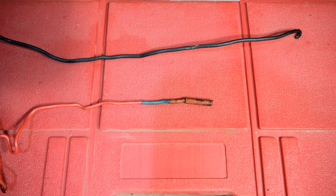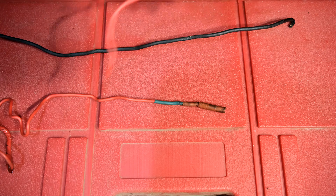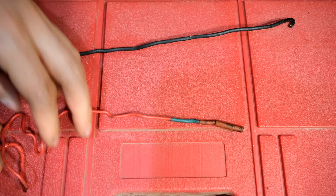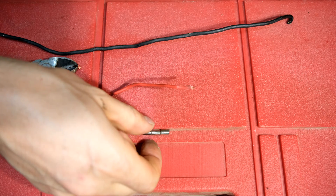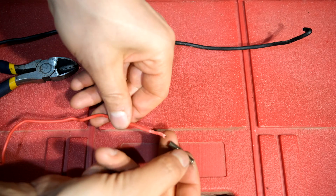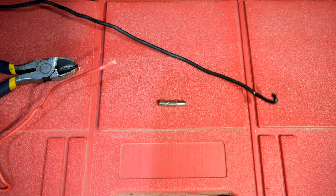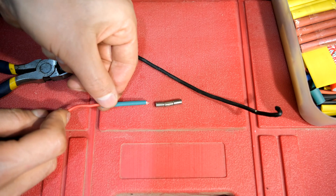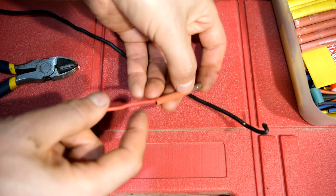Here's the fish line, and I'm going to tell you how to make your own one. This is 1.5 millimeter electrical wire - I took electrical cable, twin plus earth, solid core, about a 40 centimeter length. You will need something called a neodymium magnet. I used three of them, and all I did is attach them to the end of that wire. If you use insulation tape you'll find it's too fat, so instead I used heat shrink. The first step is to put the heat shrink on the wire so the magnets can't just slide off.